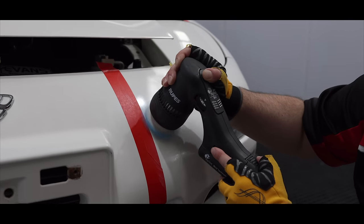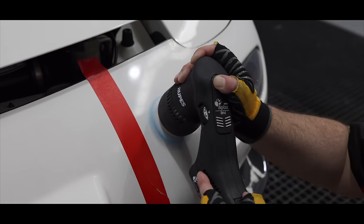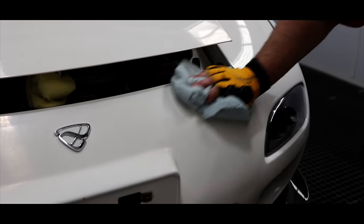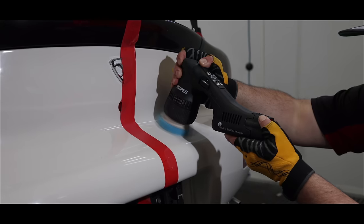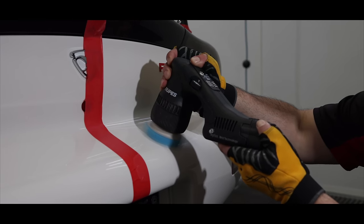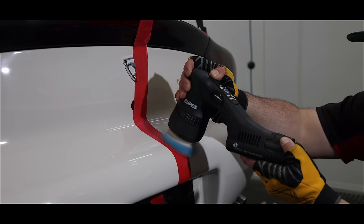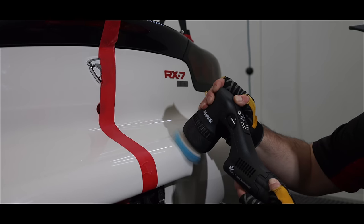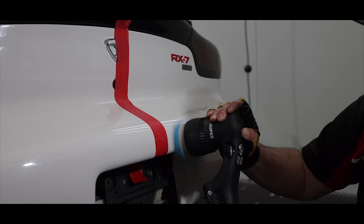For example, the front bumper was the absolute worst paint job repair and finish, with high levels of body shop sanding scratches, burn marks where the base coat and primer were starting to come through, and a very different harder clear coat by comparison. The pop-up headlights and rear bumper were only slightly better, but also not all that great. In a nutshell, about 75% of this car has softer Japanese OEM-like clear coat, with some pretty decent and also some pretty average resprays, while 25% of the panels have a harder European style paint with very little clear coat and quite horrific finishes.